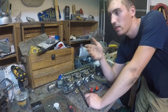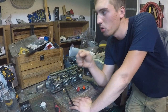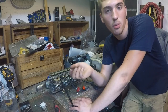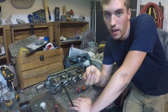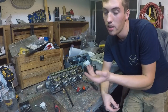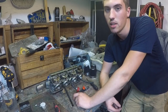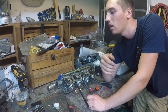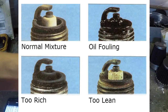There are a couple of ways to tell if your bike is running lean or rich. To tell if you're running too lean, pull in the choke — if it runs better with the choke on while riding, it's getting too much air and not enough gas. To tell if your bike's running too rich, do a burnout — if you see a ton of black smoke coming out of the exhaust, it's too rich and burning way too much fuel. You can also check your spark plugs to learn the different characteristics of lean and rich running.